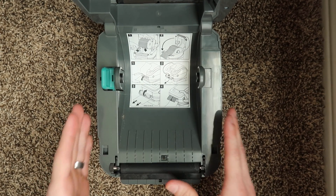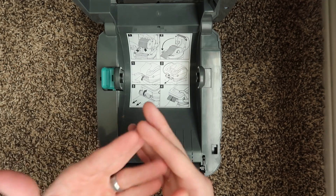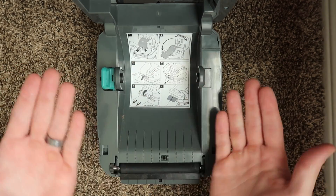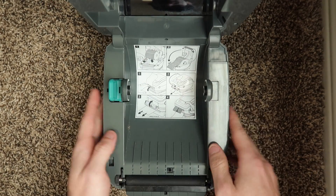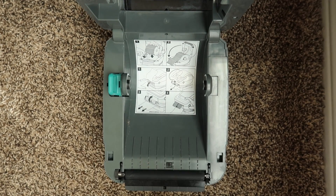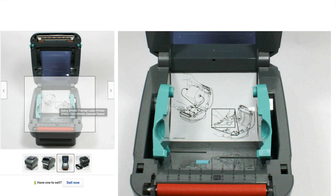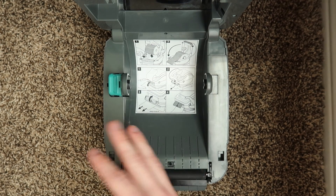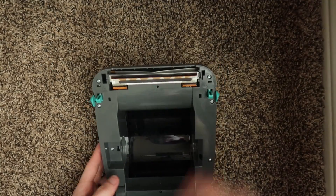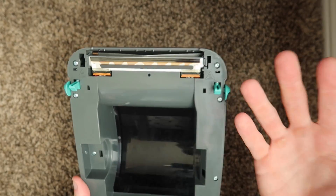This printer does not take proprietary labels, which is a big selling point for a lot of people. They don't want to be limited by the manufacturer to buy their specific labels. The Dymo and the Brother both have proprietary labels, which can be a turnoff. We have loading instructions right here, and this specific model I have has a loading mechanism designed for 4x6 labels and doesn't have feed guide adjustments. I'll overlay a picture of the other type of ZP450 that is more flexible with label options — there are slight variations between the two, though they are both ZP450s. On the top here we have the print head, and these pieces of silicon technology are replaceable if they go bad, which happens after a million or so prints.